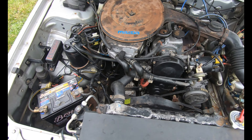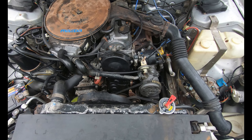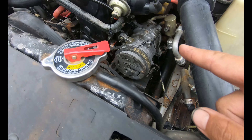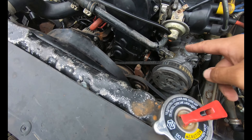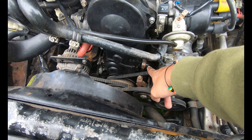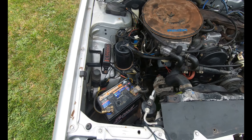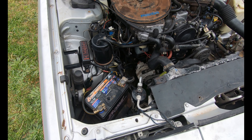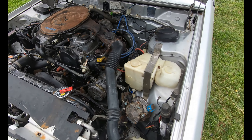So to be honest, we actually got pretty lucky with the motor. All I've basically had to do is service the vehicle, fix the leaky Welsh plug with a new Welsh plug, plugs, oil, and fix the lower radiator pipe that connects to the water pump that was rusted. But besides that, some fresh fuel, another second-hand alternator off the other 929 as the original one was overcharging, a battery, and it purrs perfectly.